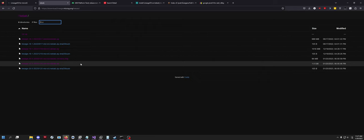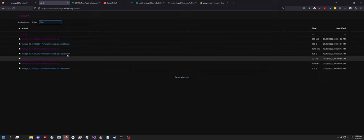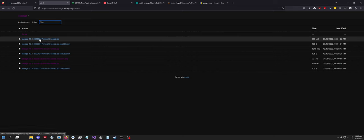The auto brightness profile on the stock ROM is very aggressive, and it seems to actually cause some issues where it literally flashes. You will see it flashing. It'll go from 20% to 60% to 20% to 60%, almost like a strobe light, a very slow strobe light on like Halloween. Don't recommend those two. LineageOS 20 fixes that from what I've seen. There's also an issue with audio on 18.1 where it doesn't seem like you have control over audio, and audio kind of goes up and down. So don't recommend that either.